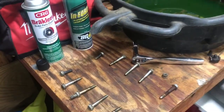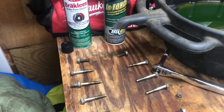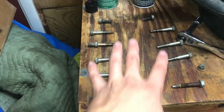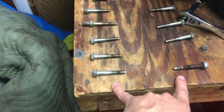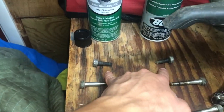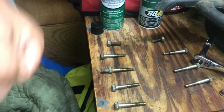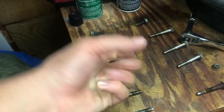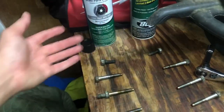This job is way, way involved — be advised if you're going to do the lower intake manifold removal and gasket replacement on your 95 Mustang or Fox body Mustang. I've taken most of the lower intake manifold bolts out. Looking at them in order: driver side and passenger side, rearmost toward the firewall going forward toward the front of the car. Unfortunately the two front bolts broke. I was feeling it with the ratchet — they were so tight I couldn't get them to break loose with just a 3/8 ratchet. So I had to put a cheater bar on it, worked it righty-tighty just a hair to free it up, and then when I went lefty-loosey, both of the front two snapped. Maybe that's a common problem with age.